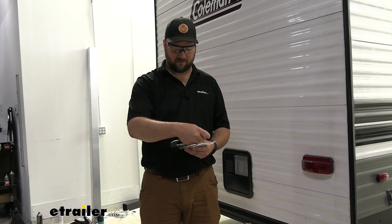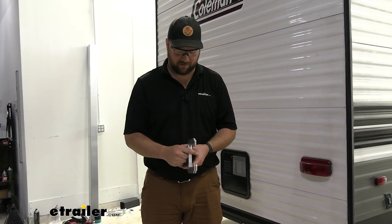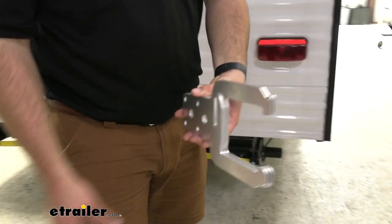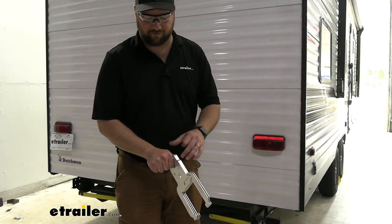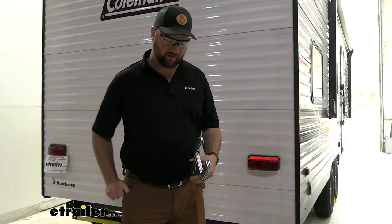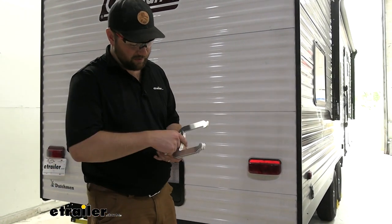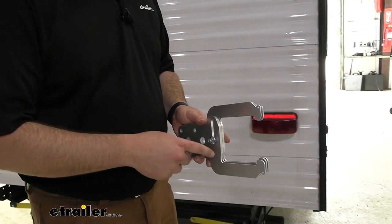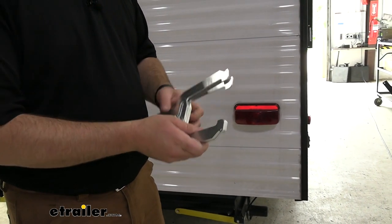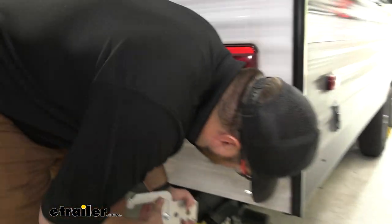We'll take the five brackets that come in our kit. Take the second one from the top, flip it over, and the fourth one from the top, flip it over. That's the easiest way to get them configured — you'll have three on the bottom and two on the top. This is what's going to hold our bumper. The reason for two on top and three on the bottom is that they're staggered so you have one flat pack, but they'll be staggered so that when you put the ending bracket on, they'll line up perfectly with the slots. We'll take a bolt — you'll have a couple of different packs of hardware in your kit, one pack with just two bolts and two nuts, and that's what this is for.